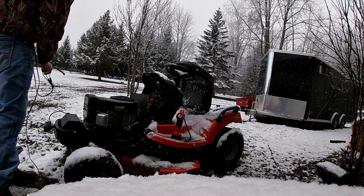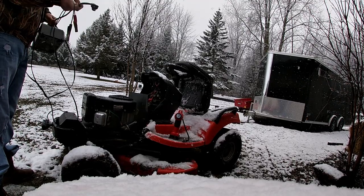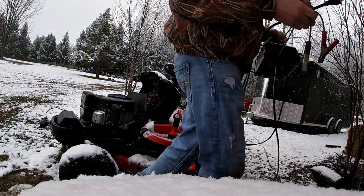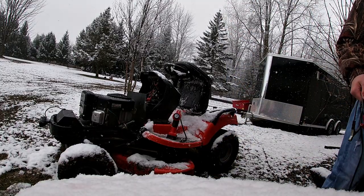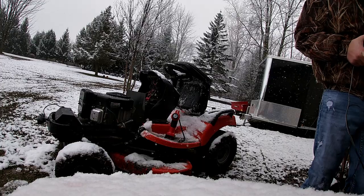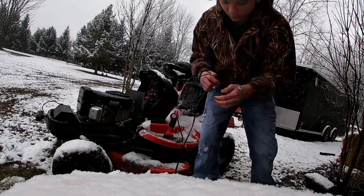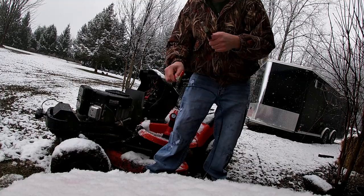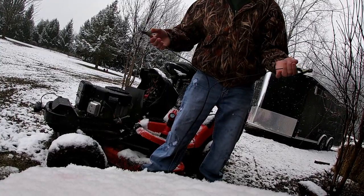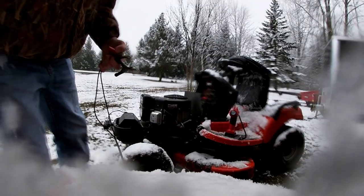All right, so I'm jumping something, or not necessarily jumping, but putting something on the charge. You have your cord that you can plug in. You want to wait to plug this in, so we're going to throw this inside and make sure it doesn't get wet. I have my battery on 12 volts because it is a 12 volt battery, 6 amps because it's a higher charging rate. You can tell when one of these is off because it makes no shock, nothing's coming off of it. It's not alive. So when you're hooking to your battery, I caught my camera.